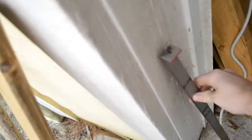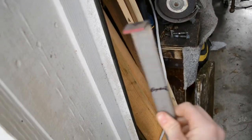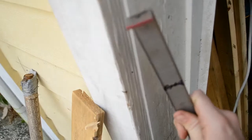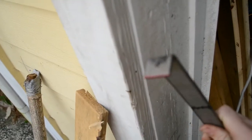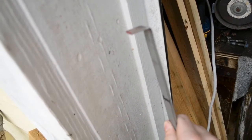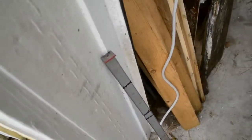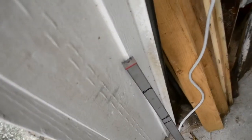I'm using a piece of bar steel — it's decently thick, and it's going to be on edge so it should be even stronger. I've gone ahead and bent this with just a hammer and my vise. That's going to be one of the ends that attaches to the down pipe, which does have a bracket welded to it already. That's important because if you don't have that there, there's no point in making this because you won't have anything to attach it to.